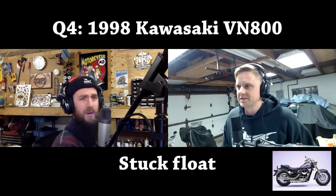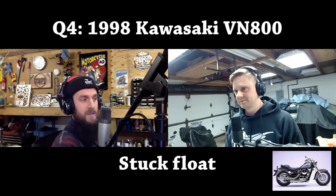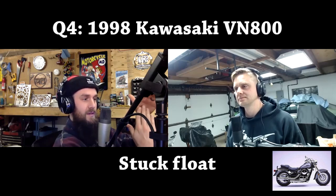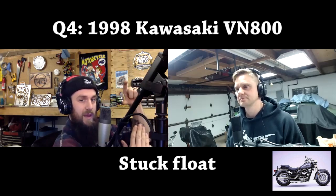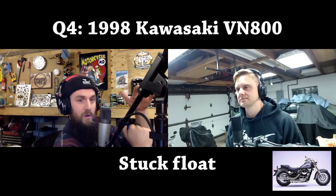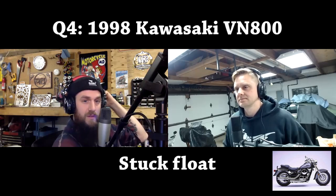Rare case. That's a six cylinder, right? Six cylinder motor. Oh, flat, man. Six. So, I mean, it just had to be so perfect that the cylinder was down enough with enough air pocket for it to compress, have enough force to compress, hit a wall, boom, and then snap the weakest link, which would be the starter reduction gear.